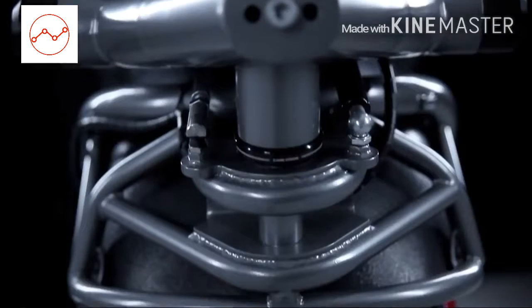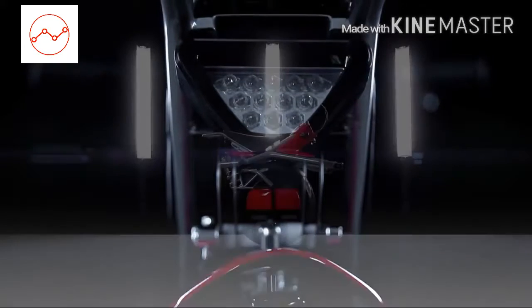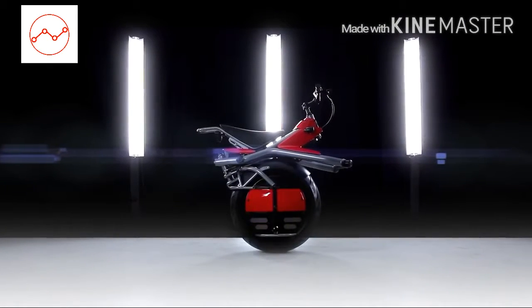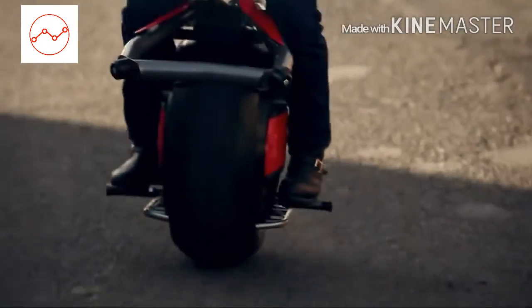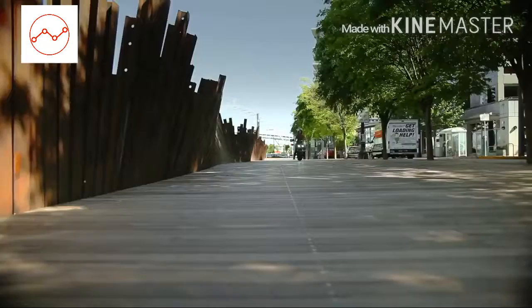We are living in an amazing time because there's so much of the subcomponents that have been integrated. We've bought and searched and aggregated all of the stuff. The magic, really, is how do you integrate all that into something that operates completely seamlessly and gives the rider an experience they can totally trust. The balance technologies in this bike rely on an interesting combination of two devices: an accelerometer and a gyro. When you update the gyro with the accelerometer, you get a really accurate location of where the center of the earth is and the tilt angle deviates from that. So the bike wants to stay on zero tilt angle.